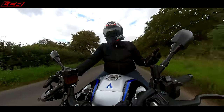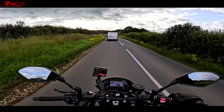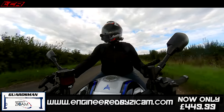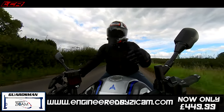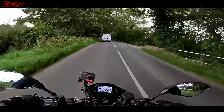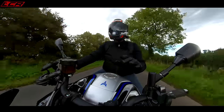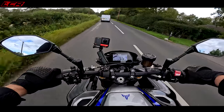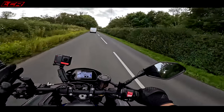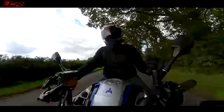Drop down to 3,000 revs and it's just gorgeous on the lower rev range — you open the throttle and you've got a load of power right there. But I think maybe the response I'm talking about is due to Euro 5. So maybe if you had it mapped and got rid of the cat, you'd get that power as it should be. It could just be the whole Euro 5 thing making the throttle response a little bit wavy. I'm being critical, but the old MT-10 was awfully snatchy. This isn't snatchy — it's a little bit laggy, there's a split second between opening the throttle and it revving. All probably down to those horrible Euro bureaucrats who insist on ruining our motorcycles.